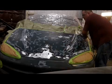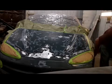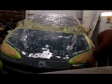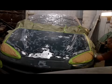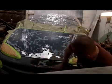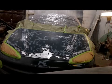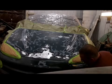At least you'll have a good clean surface here. That's very important. You want stuff to stick. And this car did just come from the auction recently, so it has been detailed. So it's probably got Armor All, things like that on it. And Armor All, any silicone-based products, oil, petroleum-based products will cause fish eyes. It's bad news.